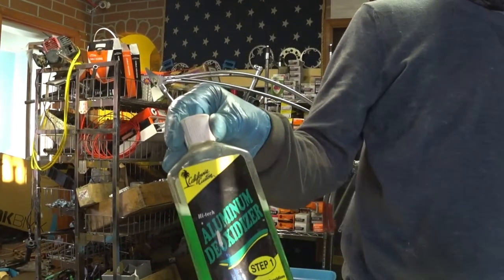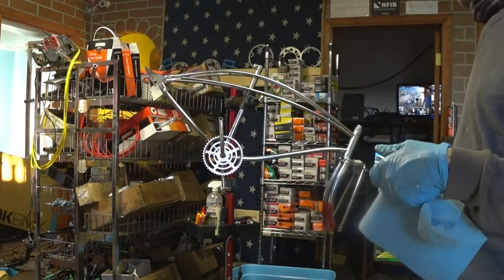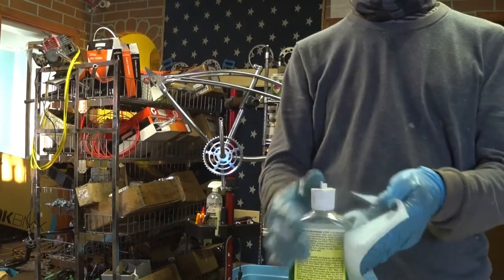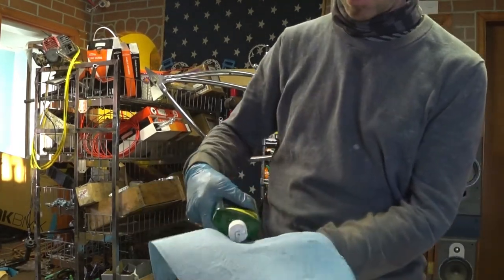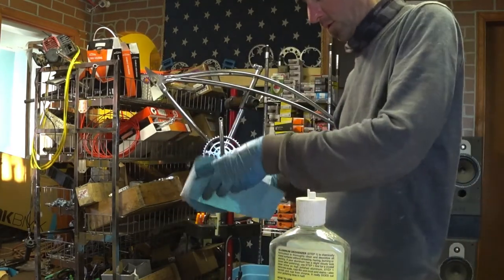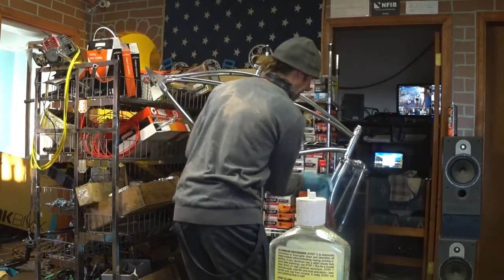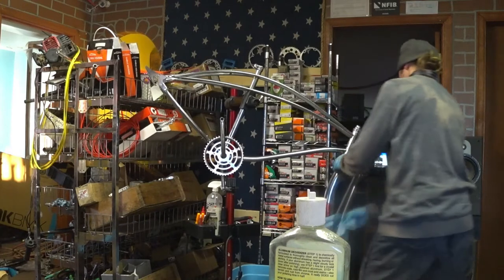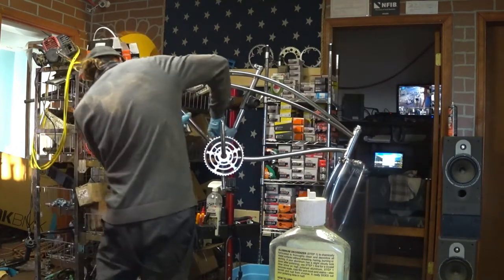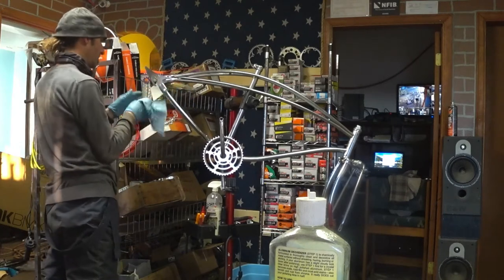This is the pre-wash — just kind of wipe off the metal. I'm going to use Purple Metal Polish to polish this frame, so that's the next step. The frame set is put back together except for the little hardware for the Springer Fork at the bottom, which I'll do when I get ready to mount the wheels. For now I'm just going to polish the thing. You've got to go slow with it and be careful; it doesn't absorb too well and will run off. This will take all the dirt and crap with it and prep the surface better for the polish — help it etch the surface a little bit better. You can smell it working; it's like an acid.